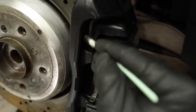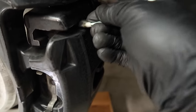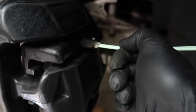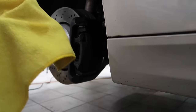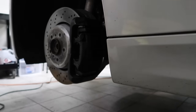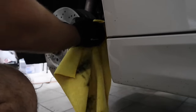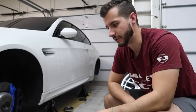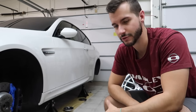Once you've sanded down the surface and it's all prepped, you've used your wire brush, and obviously a few microfibers, you're ready to wipe it down. Isopropyl alcohol is really good, or CarPro Eraser, something like that that's going to be absorbing a lot of the crap that's coming off of the wheel, and really just keep cleaning it until pretty much no dirt comes off. Obviously brakes are very dirty in general, but don't worry about that. It's always going to be kind of a little dirty around the seams no matter what.